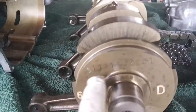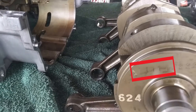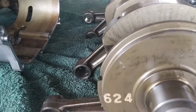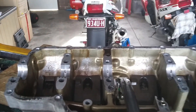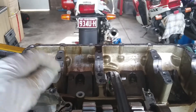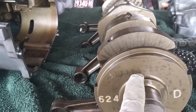Since the colors can fade, the first thing you need to look at is the numbers on the crankshaft — they are very crucial to purchasing your bearings. The first five numbers correspond to the main bearings: joints one, two, three, four, and five, from left to right, matching cylinders one through four. There's a gap separating them from the other four numbers, which correspond to the con rods.